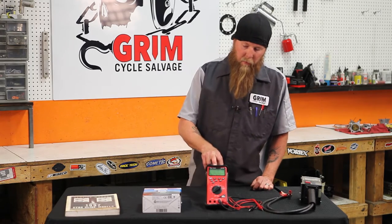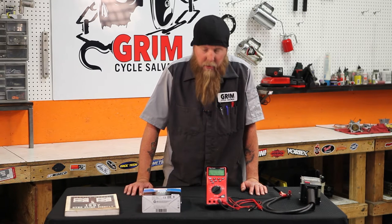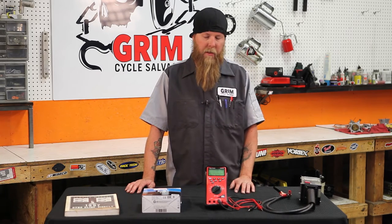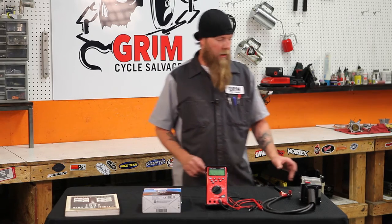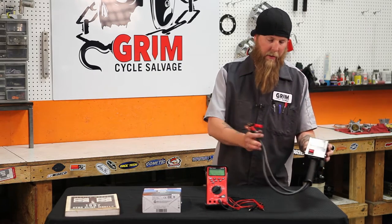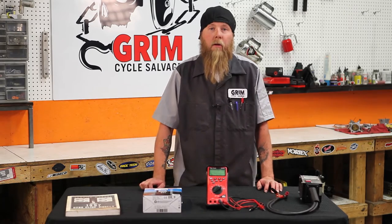The next and most important thing would be your multimeter. The multimeter is going to have all the features and functions that you'll need to test all the circuits we're going to talk about. You can get some cheap ones, and those are okay — they're not as accurate, but for the intents and purposes of this video, any multimeter will allow you to test the circuits we're going to be testing today. And then a load tester to test your battery. This actually puts a load on the battery to see if your battery can hold a load. You don't necessarily have to have one of these — I'm going to show you some tricks on how to sort of fake a load test on the bike to get an idea if your battery will hold a load.